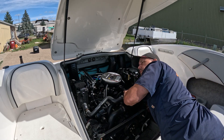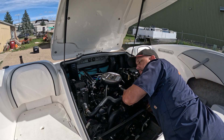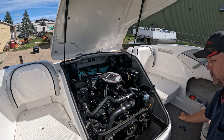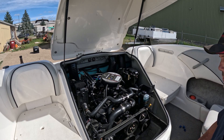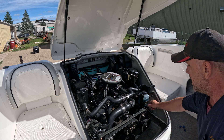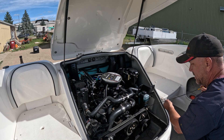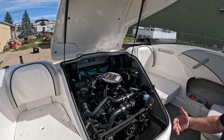So onto the manifold. These are all finger tight and again there's lots of water flow. I'm keeping track of these — set them off to the side so you don't lose them. Now what we also want to do at the same time is check the engine oil. He's not getting an oil change this year, but we can see that the oil is a little dirty but does not have water in it. So if something happens over the winter and water gets in there, we know that it happened after the winterizing process.